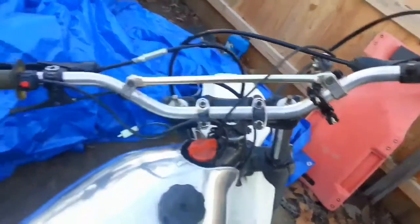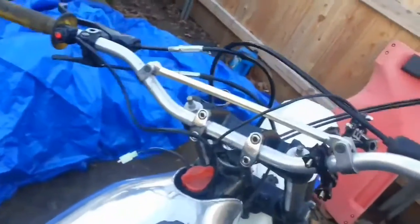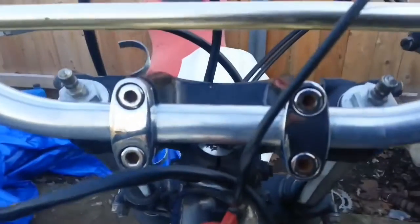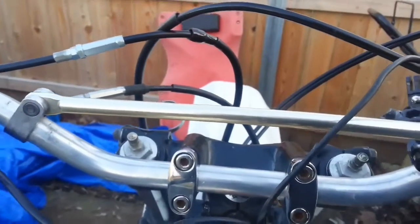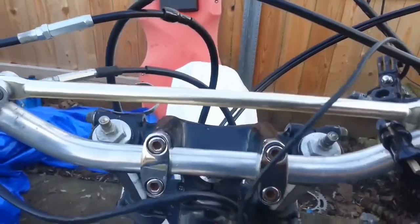After sitting on this I do like the way these bars feel after finally adjusting them. Got them set pretty far forward - I don't know if you can see that angle. Here would be straight up and down. I have them forward, but the Yamaha's got the laid-back top tree here which brings the bars about three inches off the center of your fork tubes back this way.